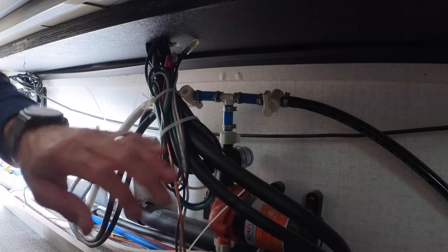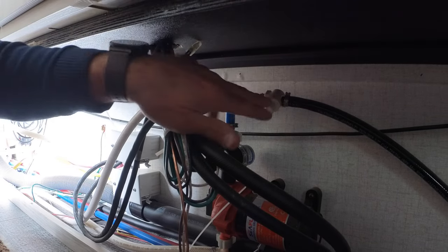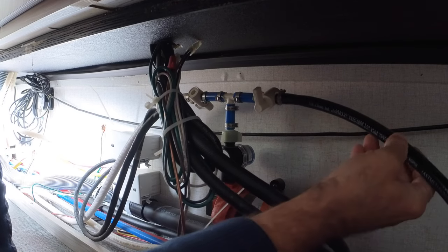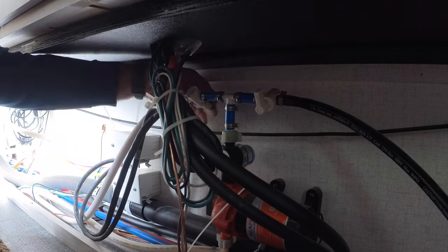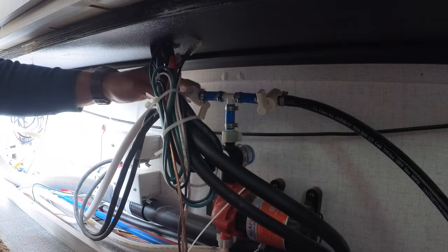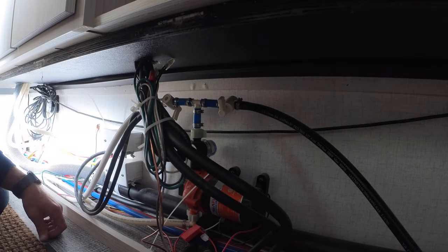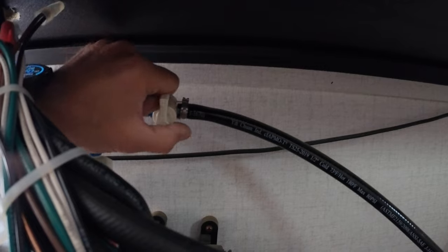I'll explain what's going on here. You have two valves on the bypass on a pump — one of them is the suction, which is attached right here. That's the suction hose and that's what we will be using to suck in the antifreeze. The other one is the fresh water intake from your fresh water tank. You want to close that so you don't pull water from the tank. So this valve goes to the closed position and this other valve goes into the open position.